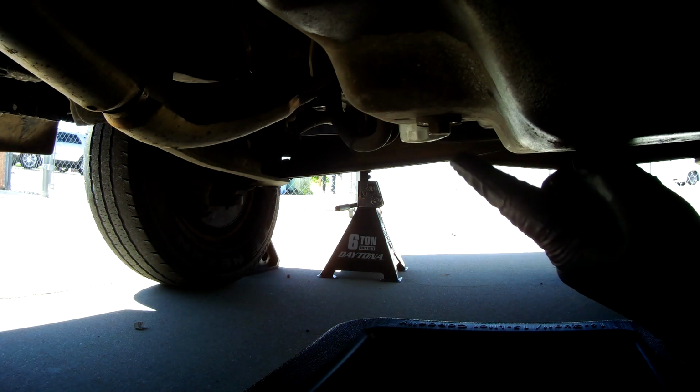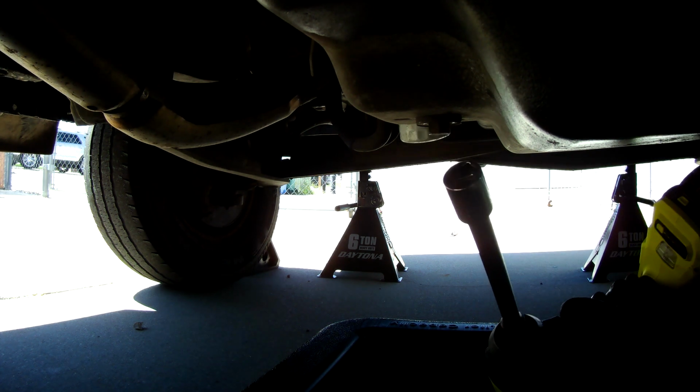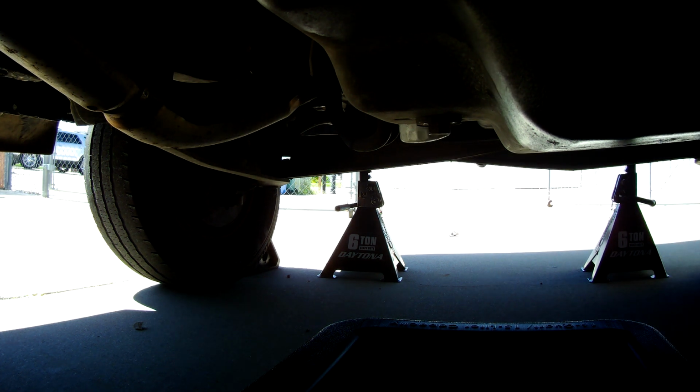The next thing we need to do is take the drain plug out right here, drain all the fluid. This transmission, right down here at the bottom in the pan, we're probably going to see about 2 gallons or 8 quarts drain out of this thing, including what drains out of the solenoid body and the filter. So it's going to take a few minutes to really drain it all, and so we'll go from there. Once we get it all drained, we'll seal it up, and once it's sealed up, then we'll get the drain pan out of here once we've managed to get all the transmission fluid.